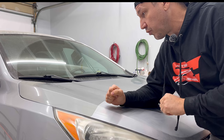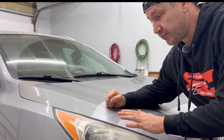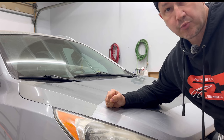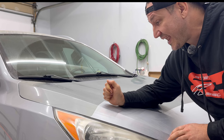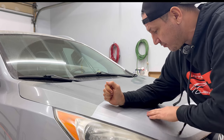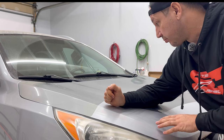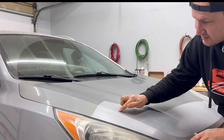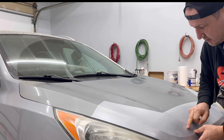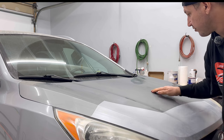To give you guys an idea of what we're gonna do, obviously first I'm gonna protect the rest of the vehicle. I'm gonna drape some painter's plastic over everything that I'm not working on. I'm gonna start with, I think, something fairly heavy, like some 180, and I'm gonna start feathering all of this back and see what we're working with underneath. And then I'll probably end up putting in light body filler and anything really deep like this, stuff that's not gonna get feathered back, it's too deep into the steel. And all this little stuff up here.